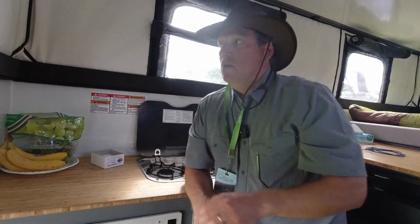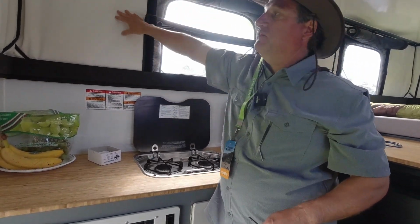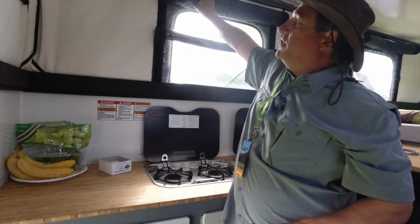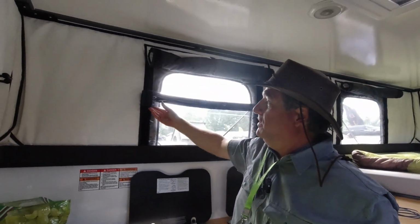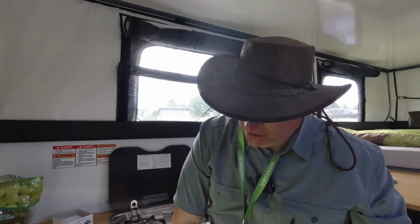This camper, Camp-X actually. Our window coverings are, as you may already know, insulated because our soft wall is insulated, right? So window coverings, they were up. The acrylic windows were closed. In 8 hours, set point of 72 degrees Fahrenheit on the Vario heater, 1 pound of propane. Minus 13 Fahrenheit. That's crazy cold too. Yeah. And in that same period of time, in the first 4 hours, my business partner ran in and out of this 3 hours, shooting wall temperatures.